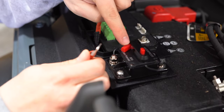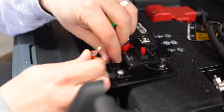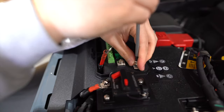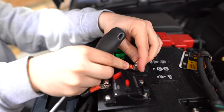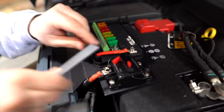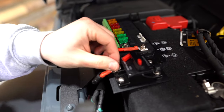Remember the bus is still open — we don't want it closed. Route the cable and connect it. The split loom is there to protect the wire because it's coming underneath here; you don't want a sharp edge vibrating while driving off-road.